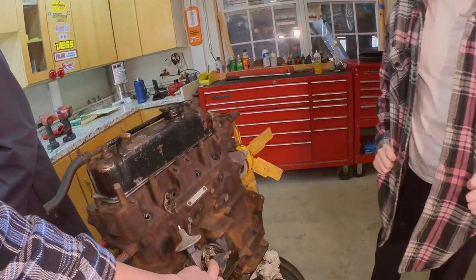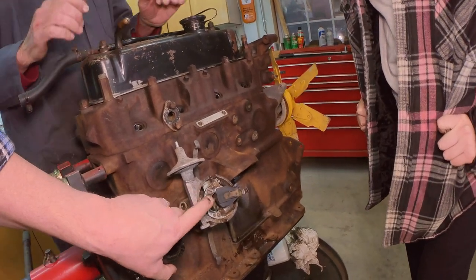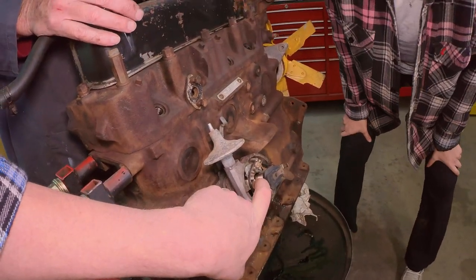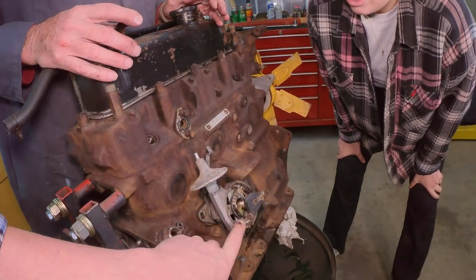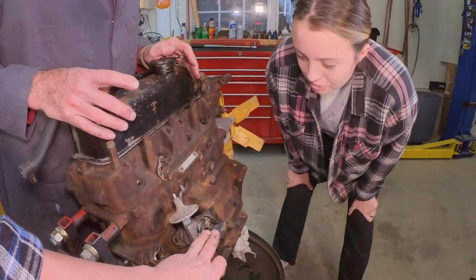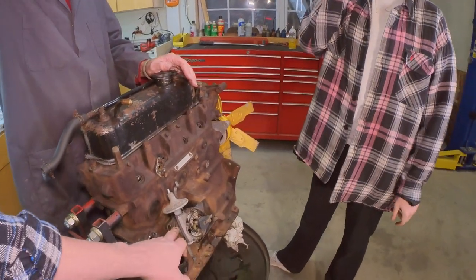And this is a point system. So the power actually runs on a cam here. There's a cam, so you can see the crustiness coming off there. So there's a cam on the distributor which opens and closes, which is like a switch. So it's like turning the light on and off to let the power go through. Yeah. All of this we don't need because we're going to do fuel injection. So we can take that off. We're going to take this off and we won't be putting it back on, although...